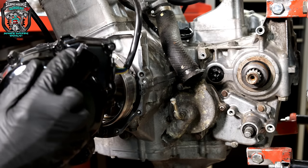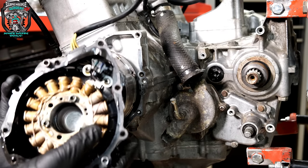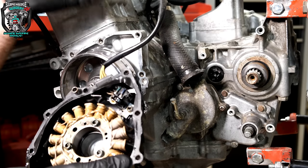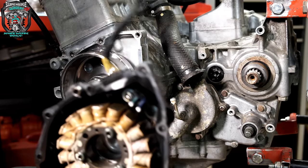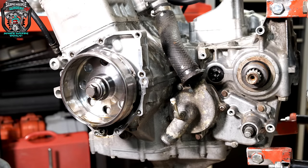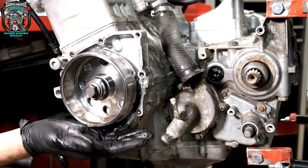So that bump on the outside of the cover is where the wires pass down through. With this one we've also got an ignition pickup on this side. Often you don't have the pickup here — on a lot of modern bikes the pickup isn't on the generator side, it's on the other end of the crankshaft. There are a few bikes that have a pickup on both sides, but that's not very common. The flywheel can stay on the end of the crank — the crankcase will split this way. I'm pretty sure I can leave the water pump where it is, though some bolts appear to be seized, so I'll leave them alone if it doesn't need to come off.